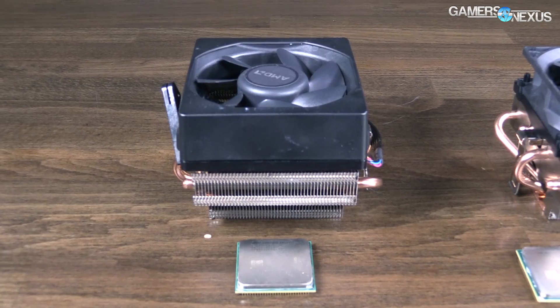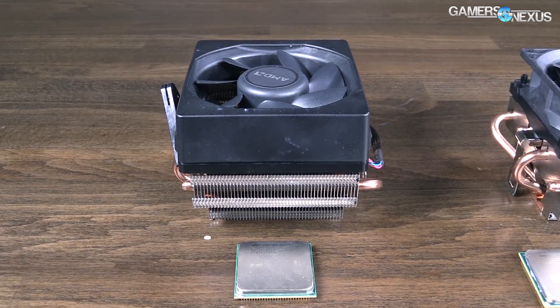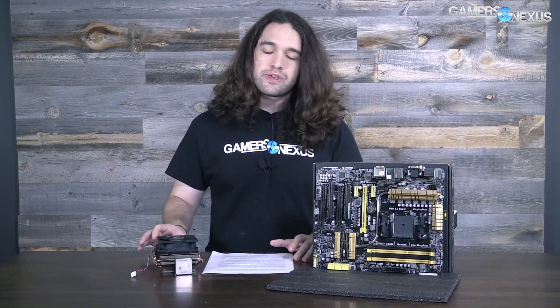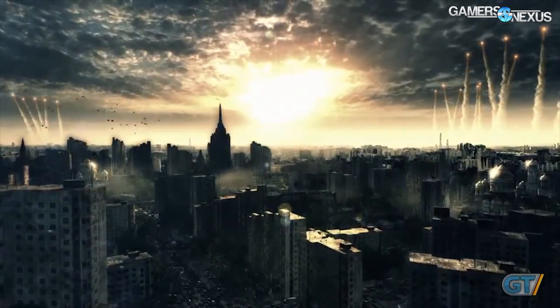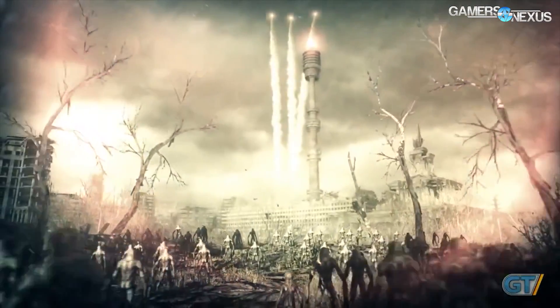The Wraith cooler is only found on the 7890K and some FX8370 chips. For frame rate testing, we provoke a CPU bottleneck by pairing these lower-end CPUs with a 980 Ti, and also pair them with a low-end card like a 250X for comparison against the APUs. You can see all the charts in the article linked in the description, but we'll go through a couple here. Provoking a CPU bottleneck helps us understand the total raw output potential of a CPU without artificial limitations imposed by other components.